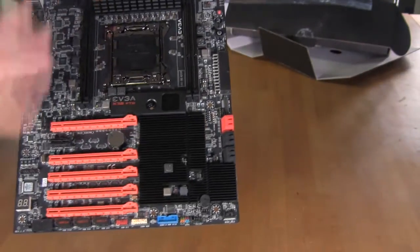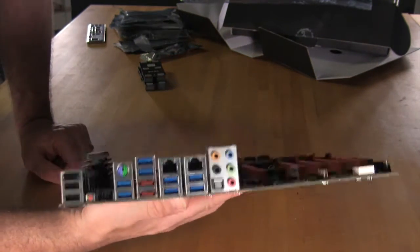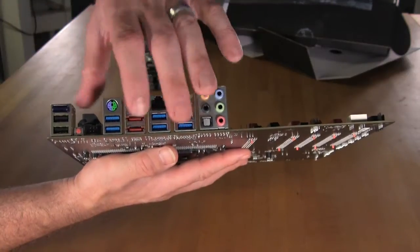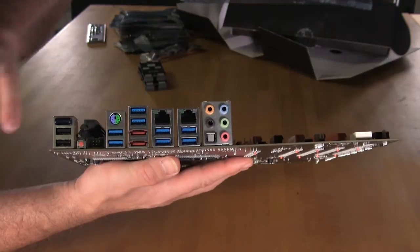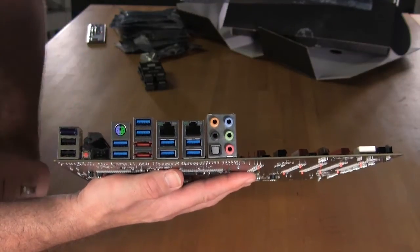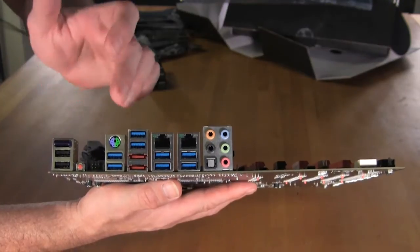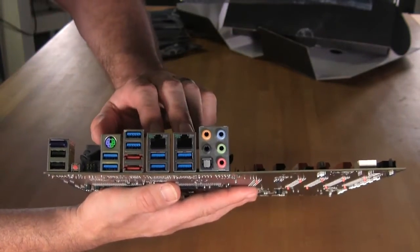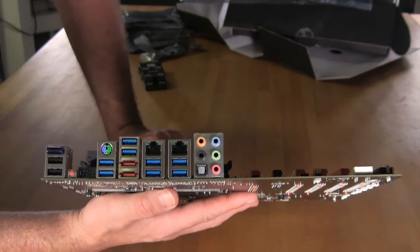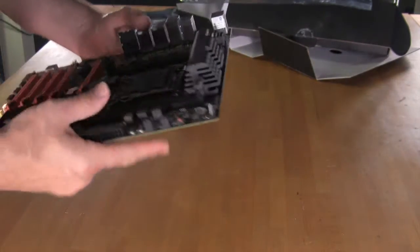That covers pretty much everything on the physical board in this brief overview. Now turning to look at the actual peripheral ports: you have more than just your standard USB 3.0 — you actually have eight USB 3.0 ports on the back, in addition to two eSATA ports and two USB 2.0 ports. This right here is actually a Bluetooth adapter, which is part of the X79 chipset and is very similar to the one Asus uses on their boards going back to the P67 era. EVGA does provide a multi-purpose PS2 port that will run keyboard or mouse. You have two LAN adapters, and a Realtek chipset codec that's going to give you basic audio — we'll be taking a listen to see exactly how well that performs. Overall it's a good clean layout and it looks like it should do well once we start overclocking.